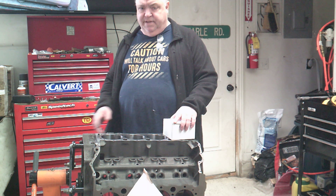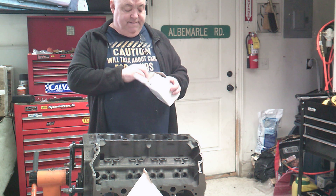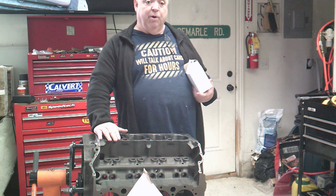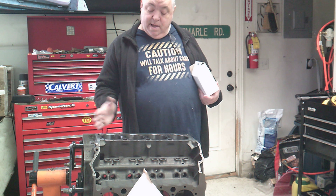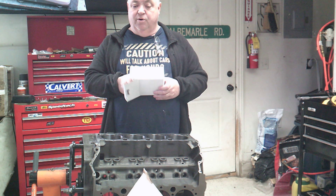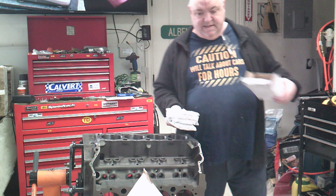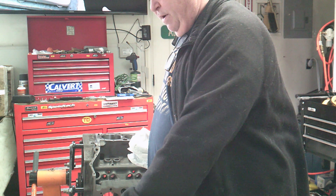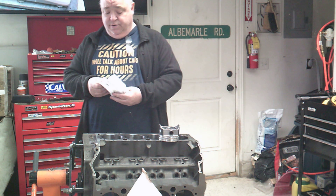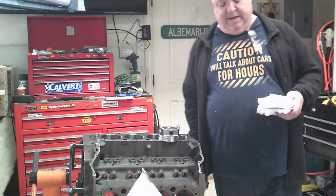In this video I'm going to be gapping my rings. When you have an engine machined, they are going to ask you for your pistons and have you bring them in because they're going to match your pistons to your cylinders — a really nice way of making sure it's a good fit. I ordered the pistons and rings that came as a kit from Summit Racing, so every piston is exactly the same, which makes ring gapping really easy. All pistons measure out exactly the same.